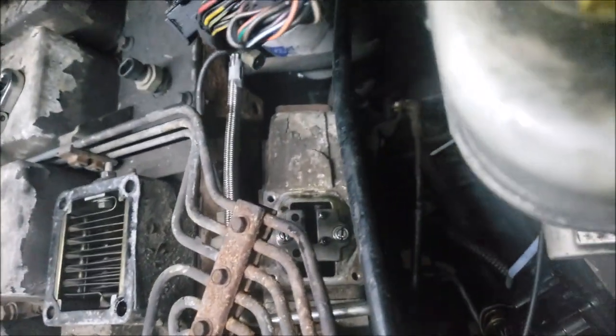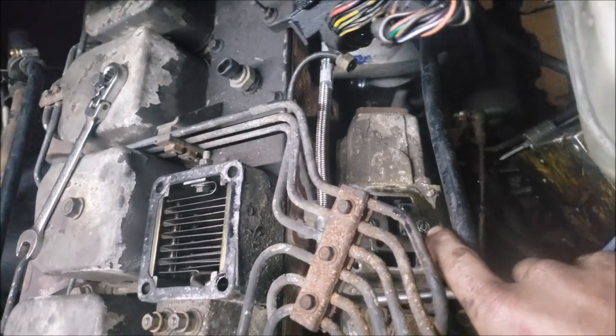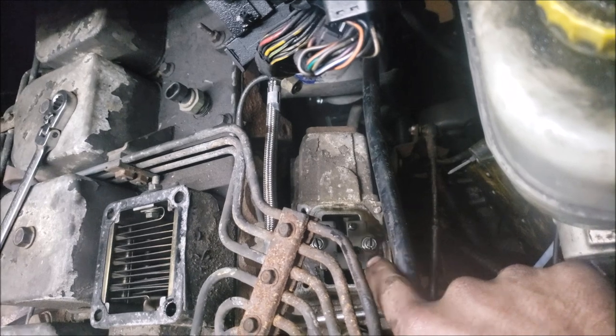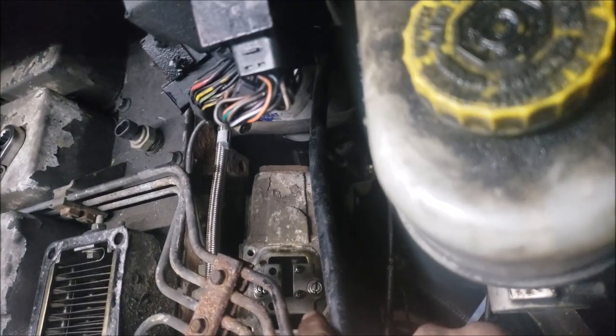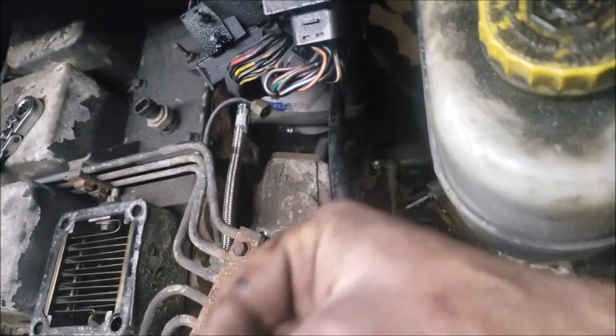The other thing is there is your fuel plate down there. So you're gonna wanna take out those two flathead screws. Do not drop them in the pump. You'll be pulling a pump. So get that off, pull that out, and then I will show you guys how to grind down your fuel plate to be a zero plate, and then you're going to want to slide it all the way to the front.